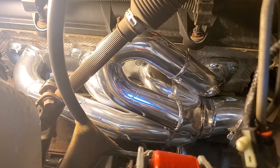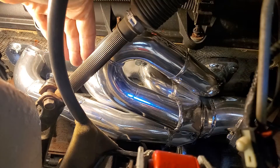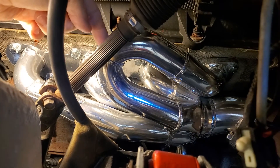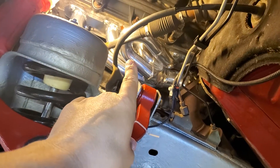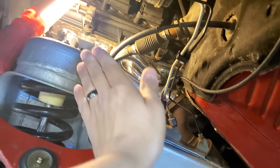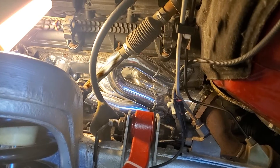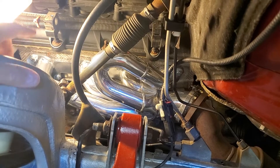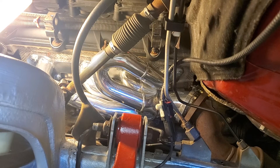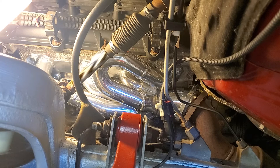I showed you at the end of last video kind of how to drop in the other header. That header had dropped in up over the top, folded level with the motor, and then dropped straight in. On this side it was different - we had to come from all the way underneath the truck and feed that header all the way up in there, fighting at an angle to slide it up into place. There was only one spot where our gasket sealer had rubbed off, which we had to touch up. But it was the simplest way to get it in there without having to take anything really apart. We didn't even have to take our steering column apart - we just had to make sure our Y-pipe was loose enough that we could slide it around and get it put into place. Once it was in place, the rest was simple with no other complications.